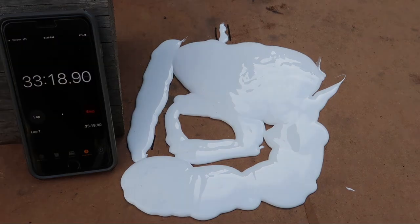Scanning back and forth through the video multiple times and watching the Dicor spread out, the majority of the self-leveling happens within about the first 15 minutes. A little bit more happens up to about 20 minutes, and then beyond 20 minutes there's not a whole lot of change. The easiest place to notice the changes beyond about 15 minutes is to watch the small open spaces in the middle of my big puddle of Dicor — you can see them gradually get smaller and smaller.